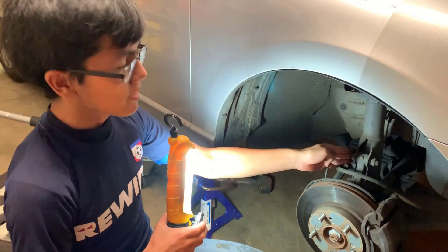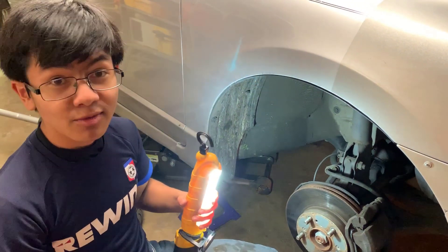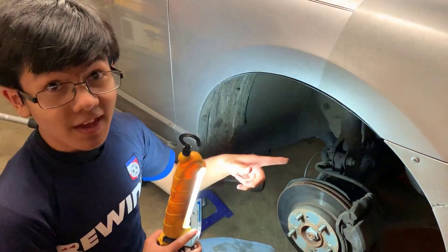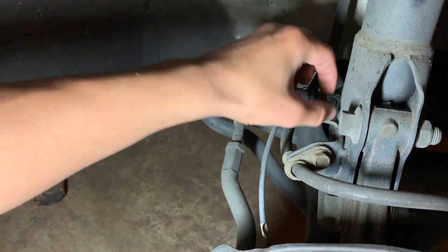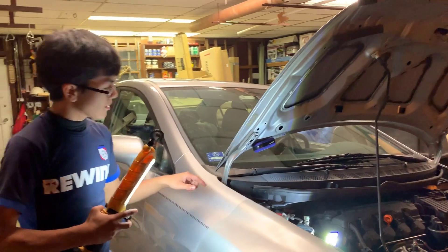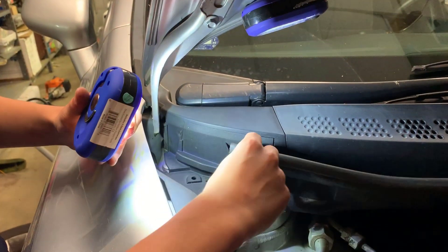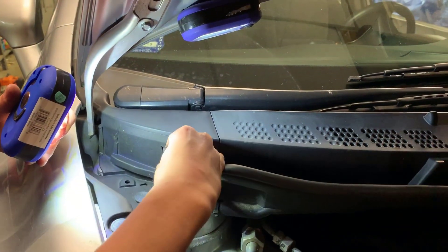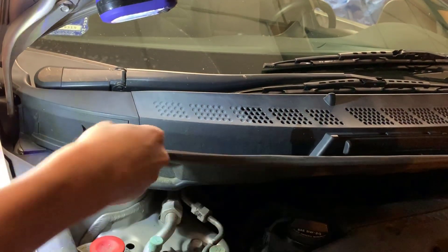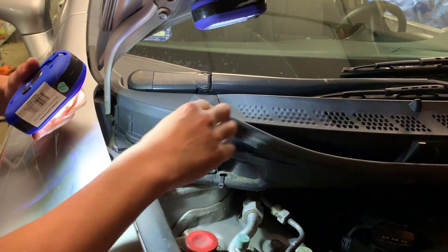On one side we're going to use a wrench to hold it in place while we screw it out on the other side using a breaker bar, and then the Milwaukee. Before that, we're going to take out the ABS line using pliers — squeeze that out. Then we're going to take out this small bolt that's holding in the brake line. After that, we're going to focus on three bolts up here. To access them, we first take up this rubber cover or lining.